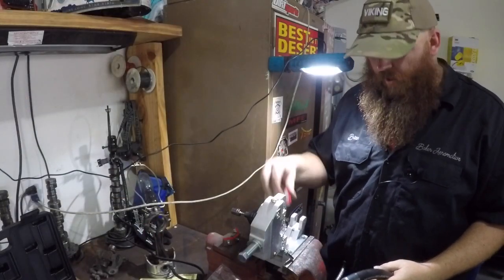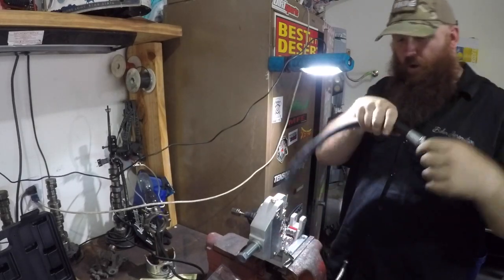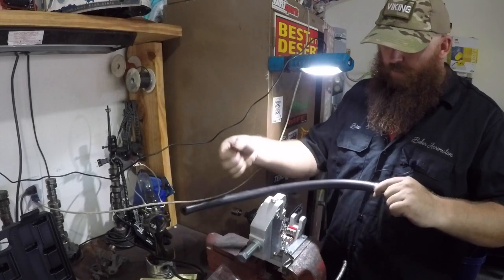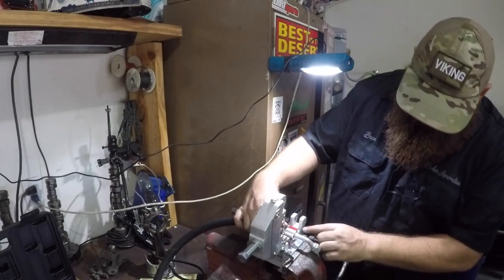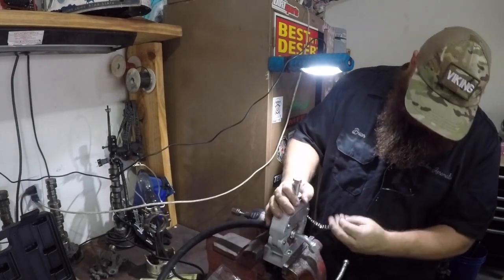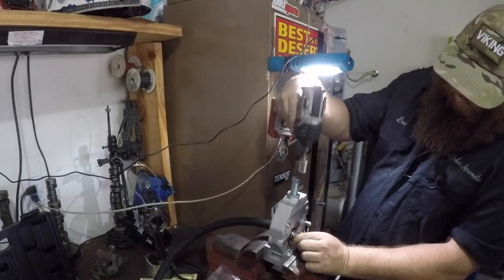We have the crimper chucked up in the vise. I've selected number 8 dies for the crimper. They're very simple to put in. We've got the hose here, and I have this one positioned like I want. If we were going to do the other side, I would be more careful about which way I have it oriented, but for the time being, we're going to slap this one closed, and there's a little mark right here that I'm sure you can't see, and we'll spin it down to that point. I'll pin it up. Alright, and work smarter, not harder.